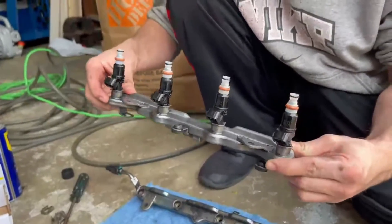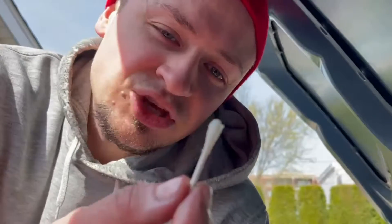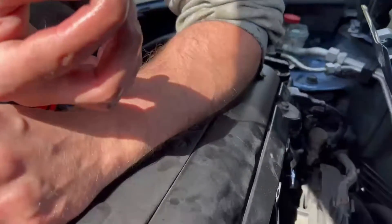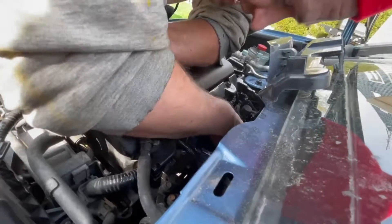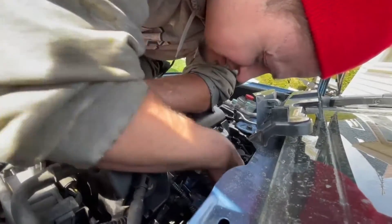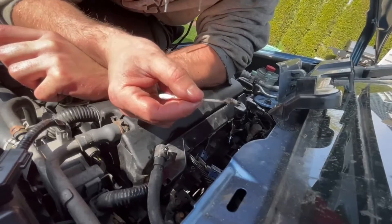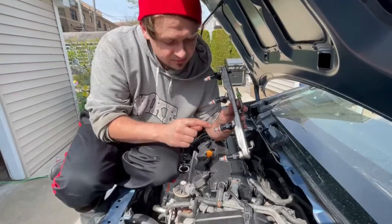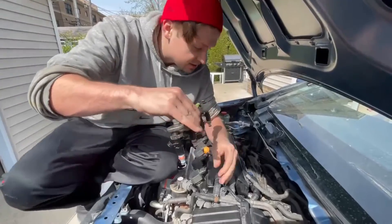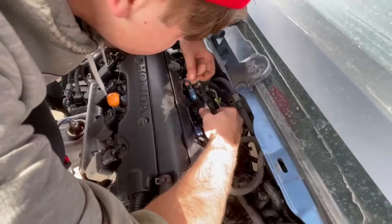Looks pretty good — we'll lube up these tips as well and then reinstall everything into the intake manifold. Right now I've got a Q-tip with gas and we're cleaning the mounting surfaces where the injectors go in. There is a lot of contamination — some dirt — and we don't want our fresh gasket sitting on a dirty surface. Even after I cleaned it a few times, look at all that dirt coming out. Make sure the surfaces are clean before you put in your new fuel injectors. We got the clips installed, the gaskets are lubricated, mounting surfaces are all clean — everything is spotless. Just pop it in.